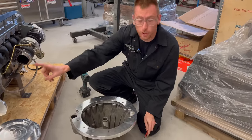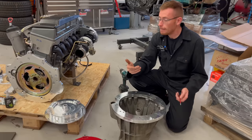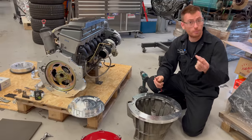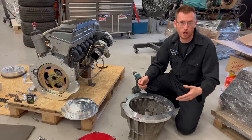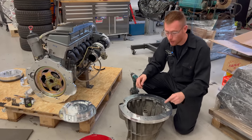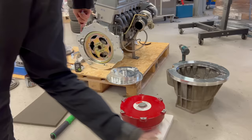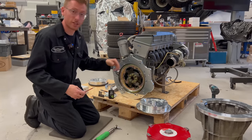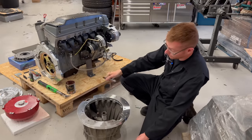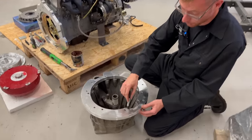The fantastic thing about that is the two small holes can be bunged with a plastic bung, or you can leave them if you don't choose to go massively underwater wading. But it allows us to retain those big M10 fixings, which are vital for keeping the strength in this whole assembly. Starter motor clearance: if, like this Land Rover bell housing, you have a notch here for the starter motor, you can see the starter motor nose sticks out slightly on the engine and that may well collide with this little bit of aluminium.